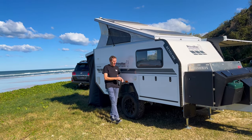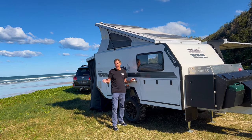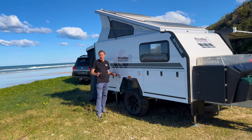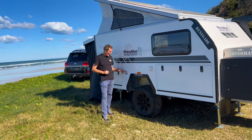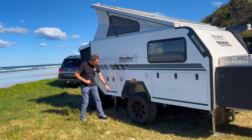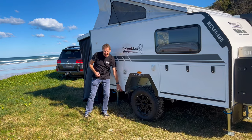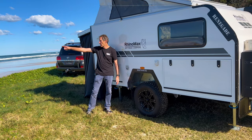Also on the driver's side, we've got our 240V power inlet — so if you want to plug into a caravan or campsite mains power, that plugs straight in here. We've got a water pressure reducer that reduces mains water pressure to a safe pressure for all the fittings inside the camper. We've got our inlet for the water tank — the water filler cap. And down here we also have our external water draw or creek draw facility, so I can put a hose in there and drop it into a jerry can, a bucket, a river, a creek, or if it was long enough, probably the sea.